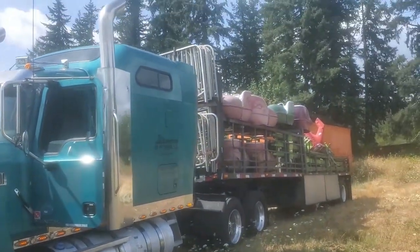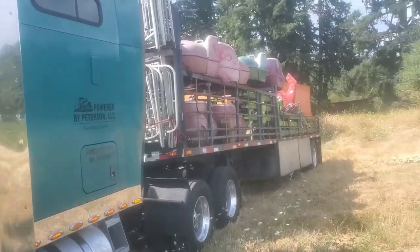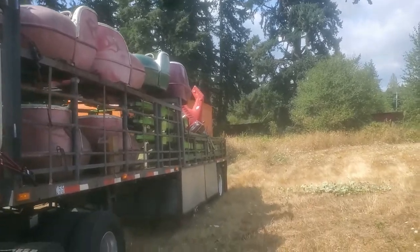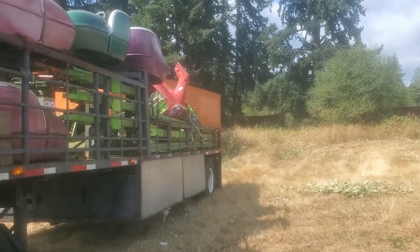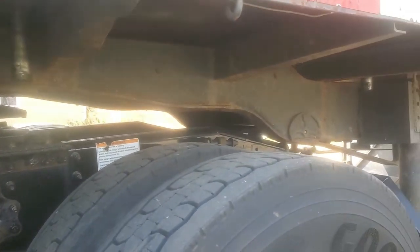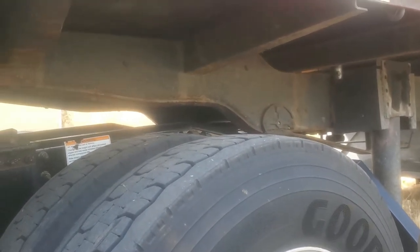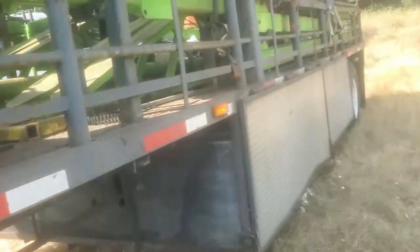I've arrived and here's the ride I'm hauling. Got some problems right away - you can see we pulled it out of the bushes, it was about 10 feet behind where it was next to that orange trailer. I've got two problems: I need to slide that fifth wheel plate all the way back otherwise it's going to hit the frame in the back, so I've got to get that fifth wheel plate to slide back so it'll clear. We don't want to tear the mud flaps off.